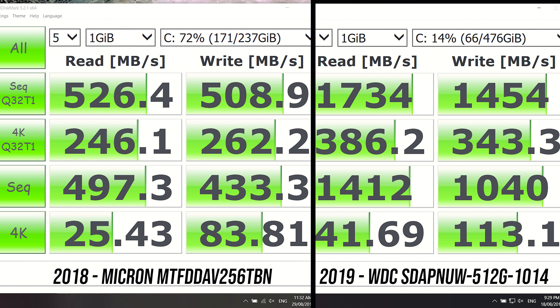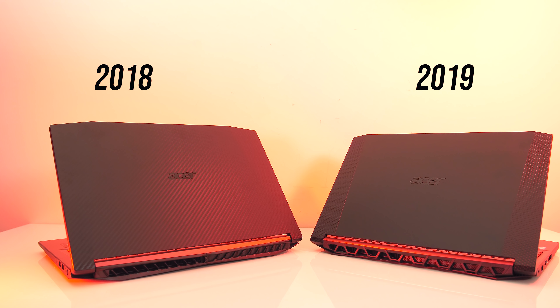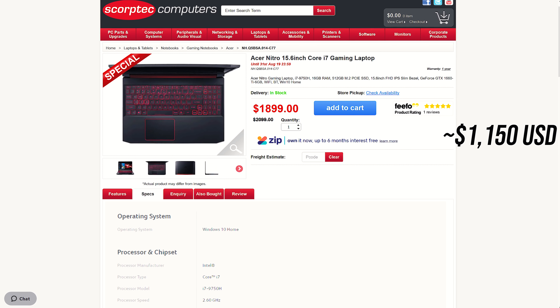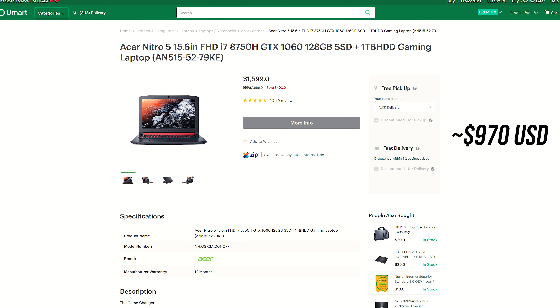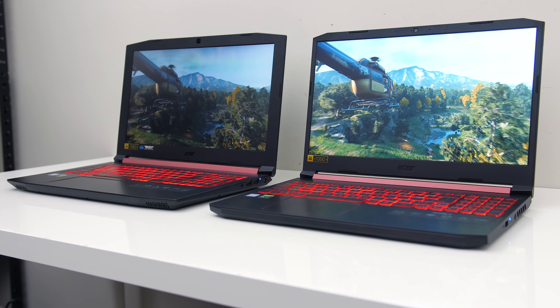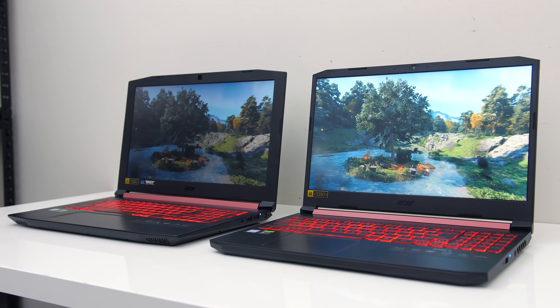I've tested storage with Crystal Disk Mark, however results will vary with different drive sizes and models may vary by region too. The M.2 drive in the old model was SATA and also 256GB, while the newer model was double the size and also NVMe, so quite a bit faster. The old model also has the SD slot, which performed pretty well compared to others. For updated pricing check the links in the description, as prices will change over time. Here in Australia the new 1660 Ti model is going for $1900 AUD, which is around $1150 USD without taxes. It seems the 1060 model is around $300 AUD less, or around $970 USD, which is about $180 USD cheaper. Simply put it's around 19% more money to pick up the newer model — honestly this seems worth it just looking at the gaming performance improvements: 19% more money for an on average 32% increased average FPS sounds okay, and that's before we factor in all the other improvements.